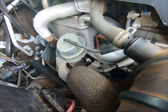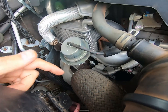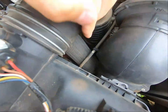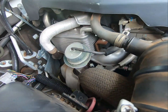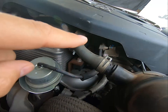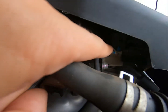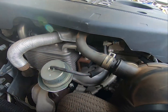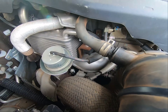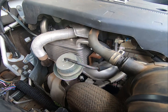This gives the computer a lot more flexibility over how the turbo boost is used. As I mentioned in a previous video, in the case of direct injection vehicles with a partly clogged inlet manifold, the ECU can simply demand additional boost from the turbo to ensure the engine still gets the right amount of airflow. However, for home modifiers, this also means you can't simply insert a pressure bleed valve to increase the turbo boost like we could in years past.